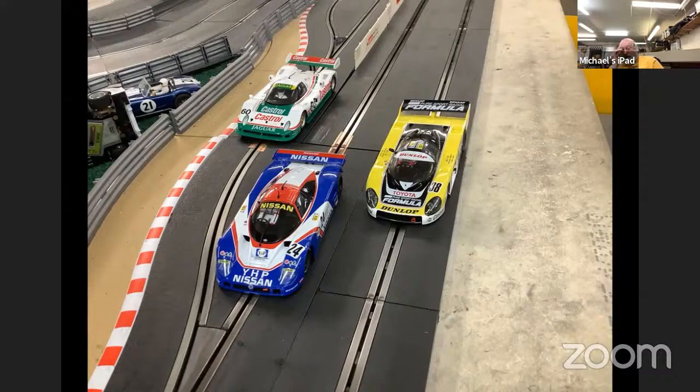So I soldered the front end, and then I took away a lot of the play at the rear. There's a bar that comes through a couple of holes there, so you have a little movement in the center pan and the outside pans. The outside pan is sort of a U shape, roughly, and the center pan is a spine with two wings, kind of a T shape with the T to the front. And I limited a lot of it, and then there's a bar through the holes that hold the back end of it on. And I limited the amount of play on that bar, and it worked a treat.